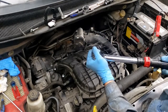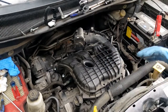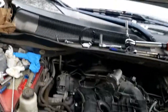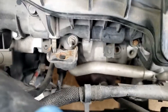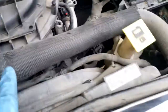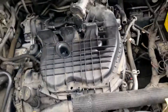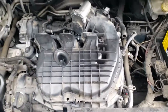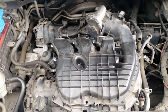This thing is torqued down. The next really important thing you have to remember is to put the support brackets back on. We have one on the left and one on the right - people forget them because the radiator hose is in the way. And there's a support bracket back here too. If you don't put those back on, there's a good chance you're going to have problems again. The new quarter inch lag bolts should make this thing last pretty much forever.